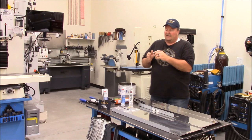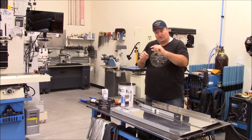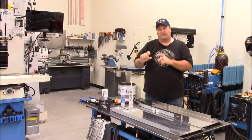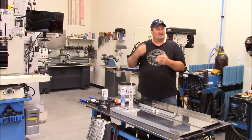Well, that does a couple of things. Number one, I don't think it gives a lot of real structural support, but more troublesome is the fact that along the top of that half inch trim piece of extruded aluminum is merely a bead of caulking that prevents water from running down and going under the trim piece onto that floor, which is just a couple layers of plywood glued together. And granted, it's a solid floor, but we all know what happens when you get water introduced into plywood. It starts delaminating, and you end up with floor rot. That's very common on these coaches.